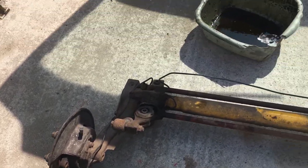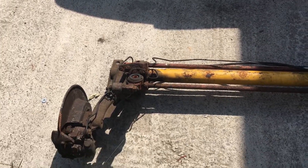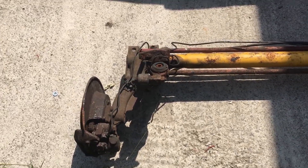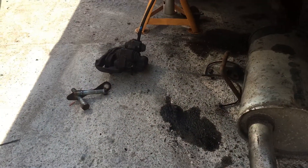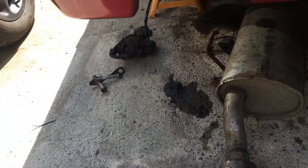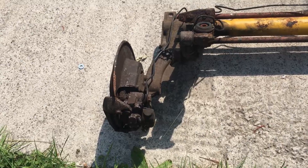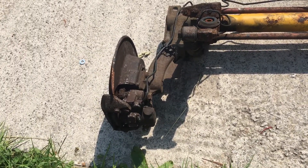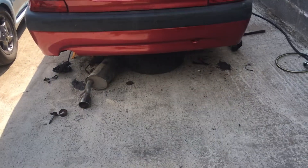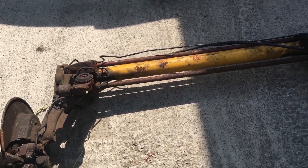This is the old one you've just been watching me remove, and this is the replacement. The next video is going to be the reverse of this — I'm going to fit the calipers, which are still attached to the car because detaching the handbrake cables is a job in itself. So I've just removed them and it's still attached. I'll prepare this axle for installation — basically removing the brake and sliding it up by the car — and then when I come back from my holiday I will finish it.